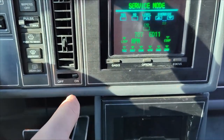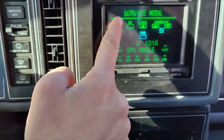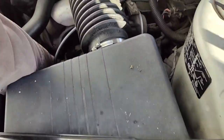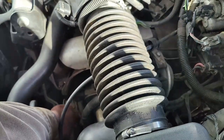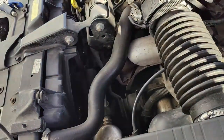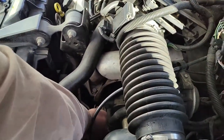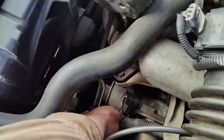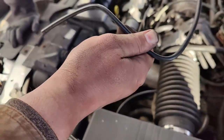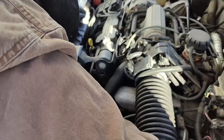But while I was playing with this, Carl and Kit heard a sucking noise coming from the engine area on the Riata. So what did you guys do so far? We found a bunch of vacuum connectors that have been rotten out there. There's little pieces of vacuum line that hold lines together. The one going to this was rotten out — whatever this is, which I'm not real sure without looking it up. And then the one coming off of this — this connector line is rotted off. And the other end of this connector line is rotted off somewhere. I've got to figure out where it went to, because it went to something over here.